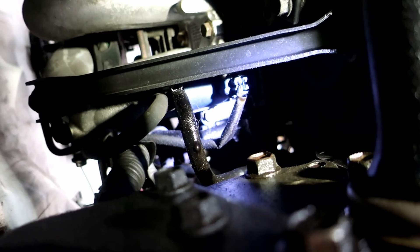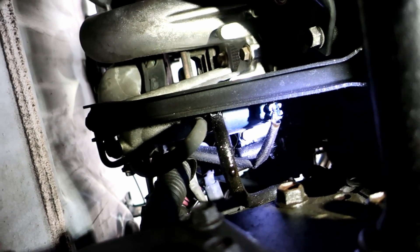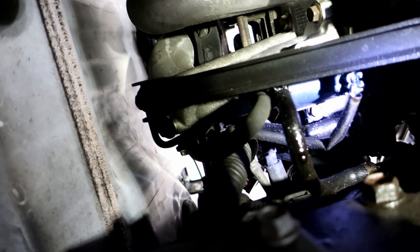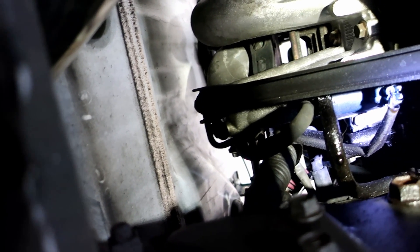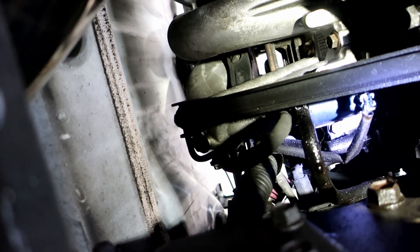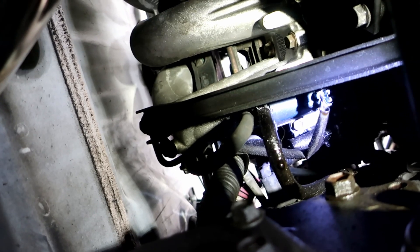You can see that little blue controller right there — that is your TVSV switch. You can see the little plug going into it. I need to unplug that. You can see a vacuum hose running all the way up and across — that ran up to the turbo. And there's one in the back which I need to trace and see where it goes, because I want to cap that off at its main source too and just get this out completely. It's only held in with two 10 millimeter bolts, so I'd rather just cap it completely and be done with it.